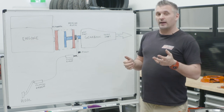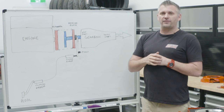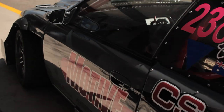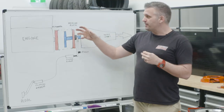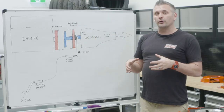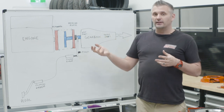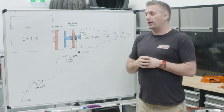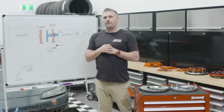Now if you've ever seen race cars, they've got tiny lightweight little clutches on them and they use like 4,000 or 5,000 RPM to take off — huge RPM just to get moving. And that's because the inertia of the flywheel is so low and the inertia of the car and all the drivetrain is so high that a huge amount of RPM is required, because as soon as they put a little bit of pressure on that clutch plate, it just pulls the revs right down.